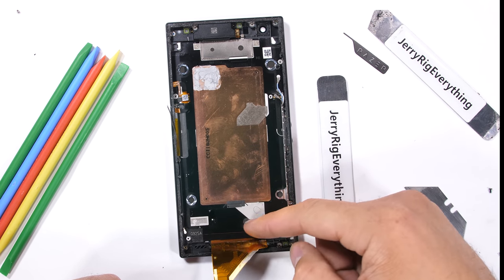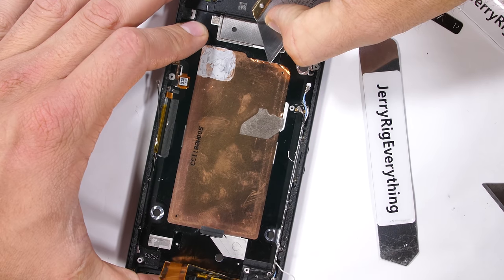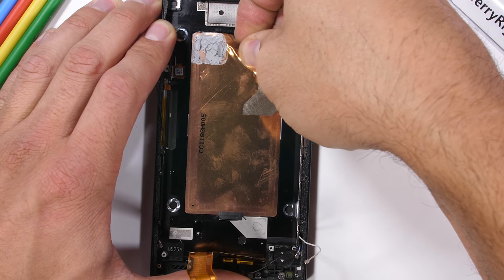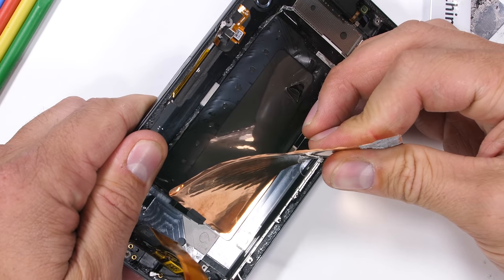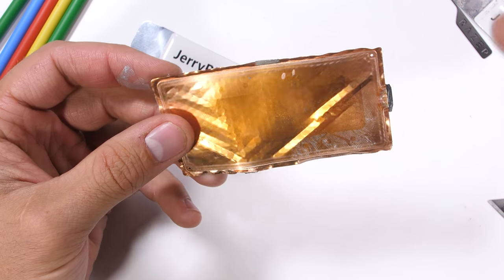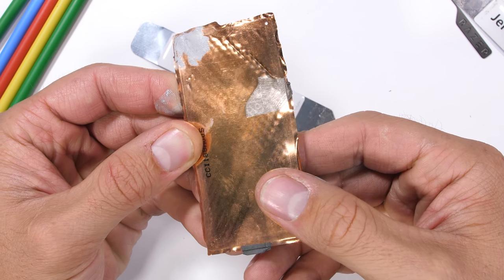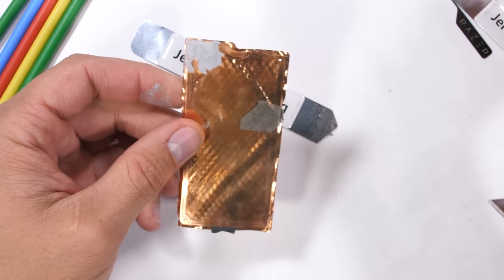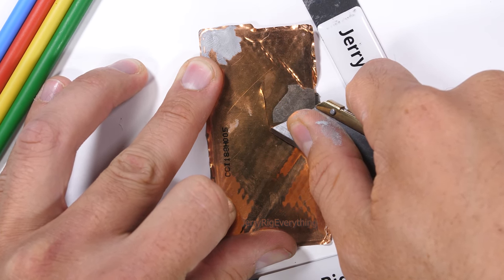Finally, we're here — the vapor chamber. Covering basically the whole area inside the phone, this copper heat sink is pretty awesome. Having a copper plate this large inside a phone is already a huge boost to thermal performance over aluminum or steel. As the processor heats up the top left corner of the vapor chamber, the vapor inside also heats up and carries the heat away to the far side of the chamber, where it cools down into liquid and flows back to repeat the process. It's kind of like a heat pipe on steroids — basically a whole radiator for your phone.